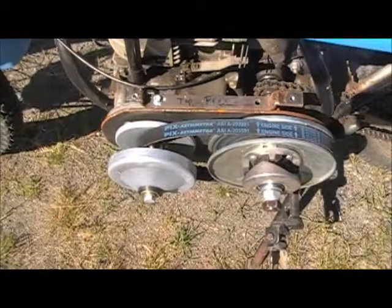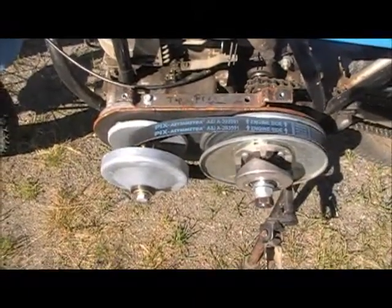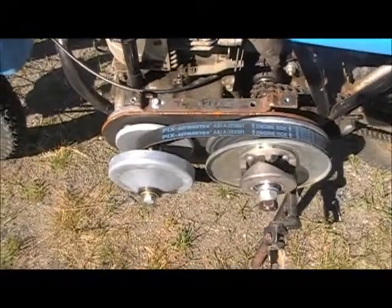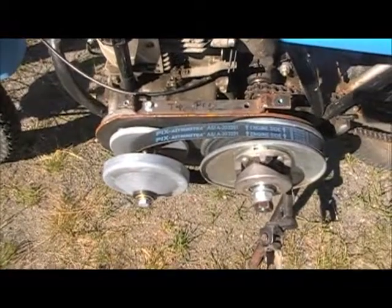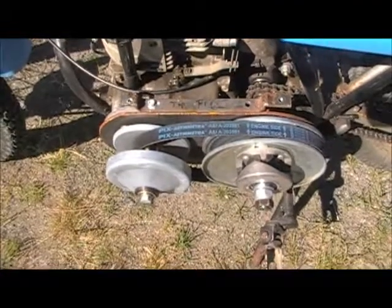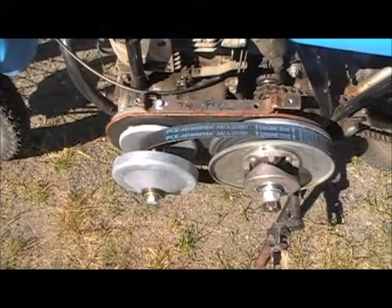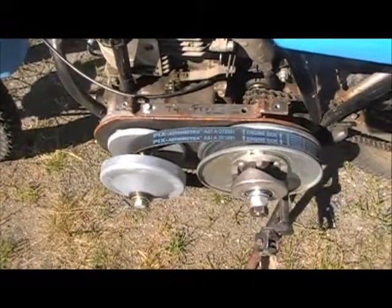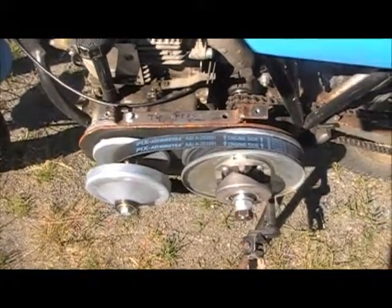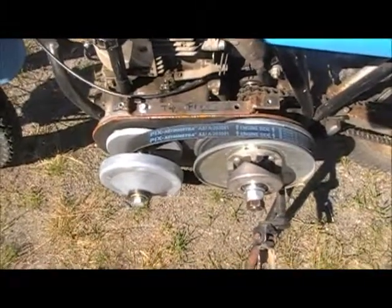There's an internal two rods that the clutch expands upon, and one of those rods came out right away after about a mile. So I had to drill a hole and put a pin in there to keep it from sliding. It's cast into the aluminum underneath the housing there. Then the plate that bolts to the engine broke in half, because it's just cheap pot metal. Another thing to consider when ordering a $80 clutch kit.